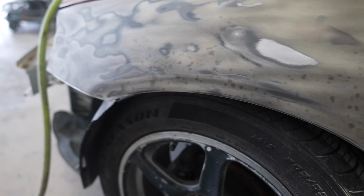I've learned a lot in this video and this has been awesome. We shot primer and the trunk looks perfect. Everything is super smooth. Primer is drying. I'm gonna give it a day to dry before I go back and block it. I sprayed some guide coat on it and it's basically ready for the next time that I come back.